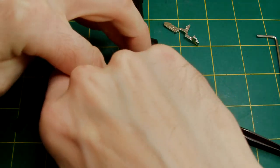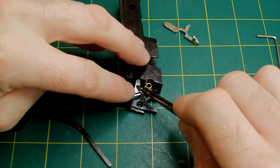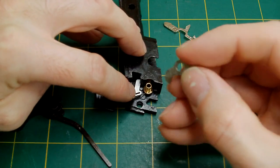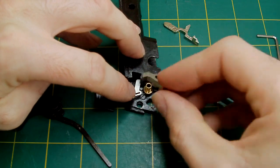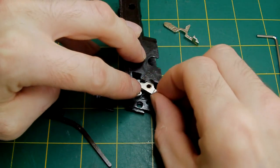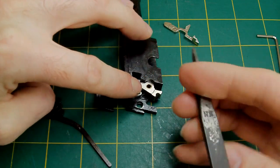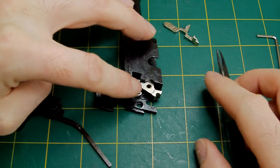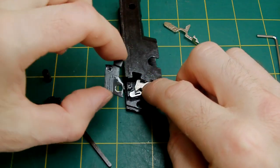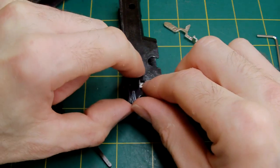Then all you do — so that's held down, that's in position, that's not going to go anywhere, at least not whilst my finger's in the way. Then you get your sear, which is this one here, and you drop that down over the top of that brass shaft or sear shaft, whatever you want to call it. That then holds that in position. Then you get the rear half — the section that is screwed into position that holds it all in place.